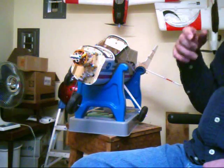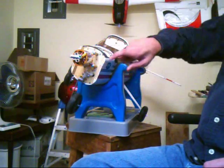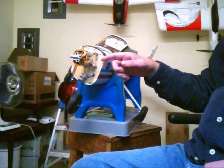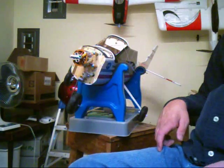We've got a guy at the hobby shop that's very knowledgeable. One of the things he told me to do was to put flat washers behind the spacers, so that whenever you tighten up the screws it doesn't cut into your firewall. That was good information there — I probably wouldn't have done that on my own.